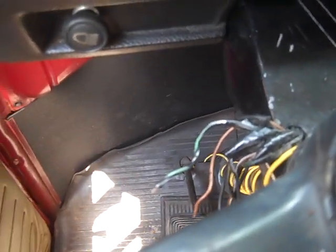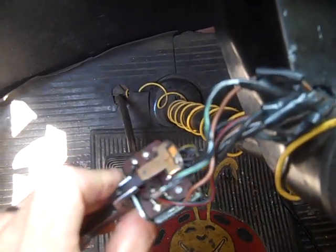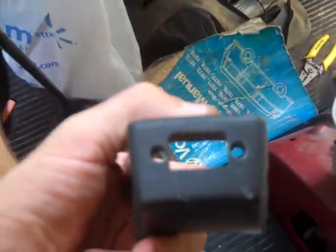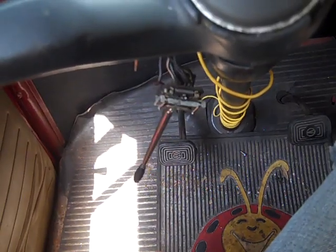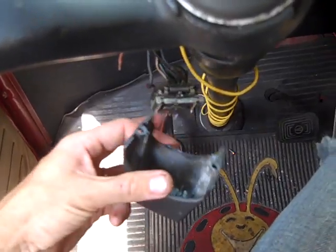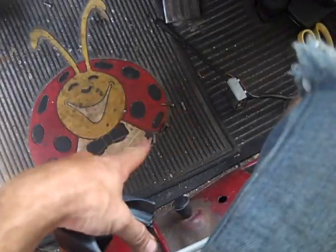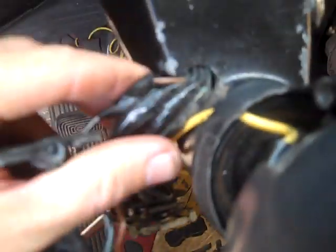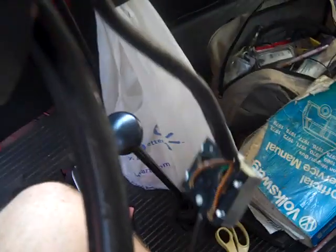Once I did that, I figured out the problem was in here. I unplugged it, pulled it out, and it had melted together. Next thing I'm going to do is solder these together and get it back in. The initial problem was that the two holes where the screws are supposed to hold the switch in place had come off, so it was just floating in there. Eventually it just broke those wires and I couldn't even turn the switch anymore — it was just flopping inside. I realized that was the issue, found two screws in my bag, and they worked out.